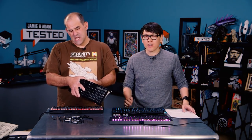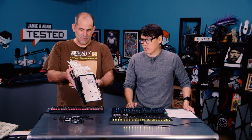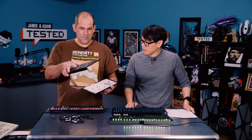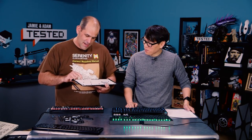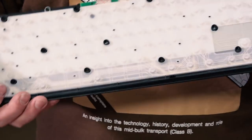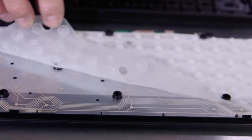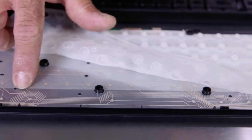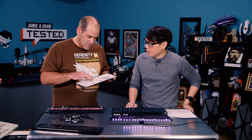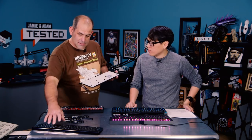We can start off with the non-mechanical keyboards. This is a membrane keyboard. This is what the vast majority of keyboards sold with desktops are. There are little humps you press and they make a contact. And literally this is cheap, this is good enough. If you work in an office there's a 99% probability that this is what your keyboard looks like on the inside — some variation where there's basically a membrane that gets pressed down, it makes a contact, and you get a key entry on your screen.